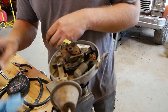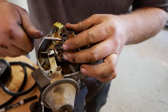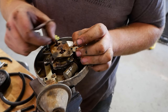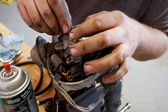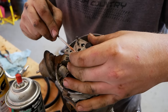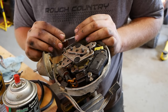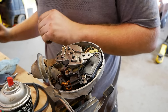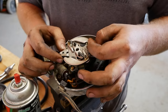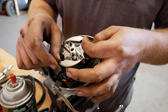I got the PB Blaster and brake clean, got the clips off the top plate so we can pop it off and clean everything underneath. Stole the spring set off a Summit distributor that doesn't fit this application. The pins look fine — actually they're perfect, we're good to go. Look at this dumb design. But now it looks a lot better — it's mostly tight in the center so it shouldn't fly open at idle.